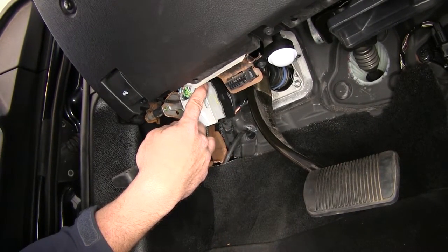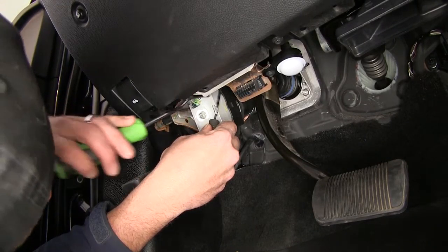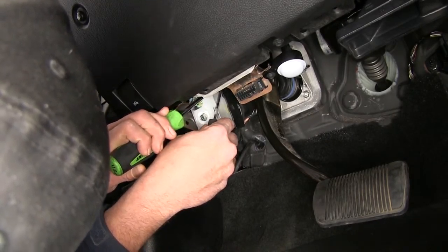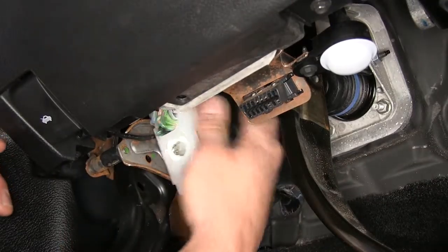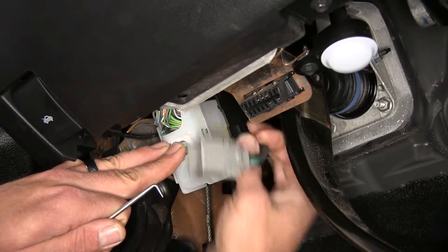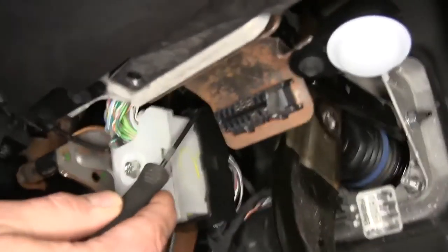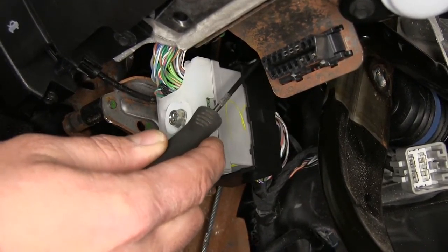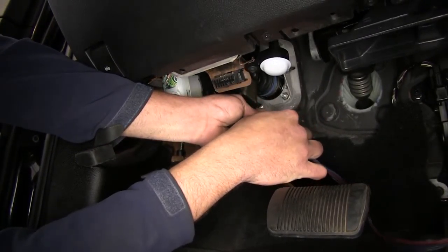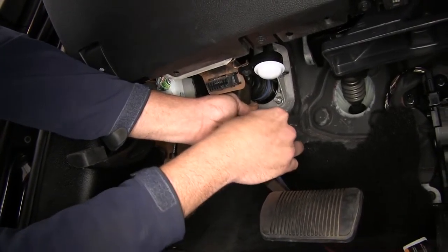Here's our parking brake lever that comes up to a little white panel. Right above that we're going to see our gray connector — that's what we'll plug into our pigtail. To release it, there's a little catch here on the bottom; we'll pull down on that and then give it a push rearward and get it slid off. Once we've got that tab released, we'll push it forward slightly and it's going to come right off and be accessible. You can see the little tab located right there — just pull down on that tab and that'll allow you to slide it forward. Now we can take the end of the pigtail; it'll only slide in one way. Slide that in, hear it click, then push and pull to make sure it's nice and secure.